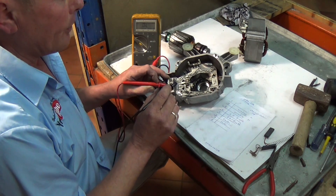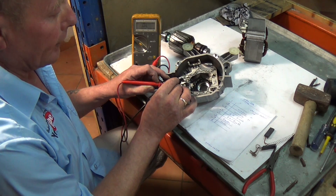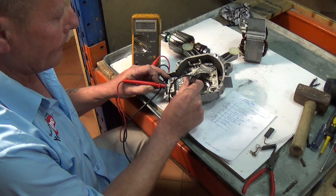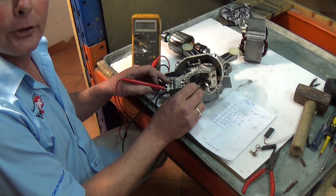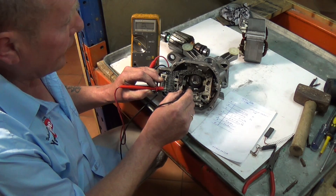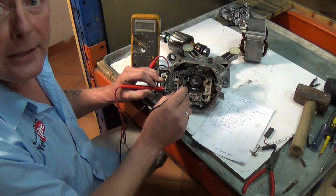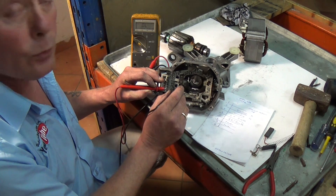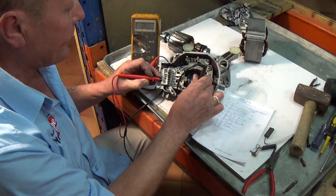If you do have a faulty heat sink you'll get no continuity on either of those two terminals, but you will have continuity on the left-hand one. Number five goes to the other carbon brush on this side - we should have continuity there. The other two go to the tachometer. I'll lift this up - the tachometer is here. It's basically a coil, and there's a magnet on the other side. As it rotates it sends the RPM speed to the computer so the program knows what the motor is doing and whether to increase voltage for spin, rinses and so on. We can double check that we have continuity to the tachometer.